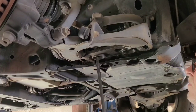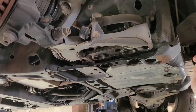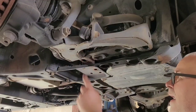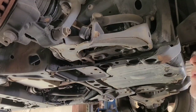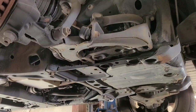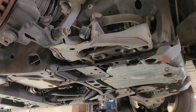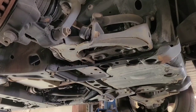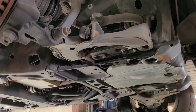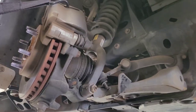Basically I'm getting it back inside the control arm. I may have to take the sway bar end link off and undo the axle nut so the axle can slide in a little bit. The inside of the back part has to come out a bit further. I got the axle nut off and I got the sway bar end link off. So now let's see if this thing will come out even further — let me try to ratchet it more. You see all the clearance I got now? That's definitely helping, still not quite enough though.